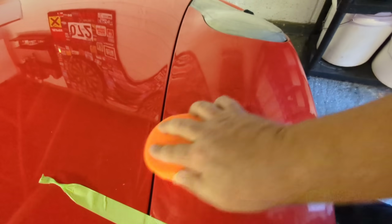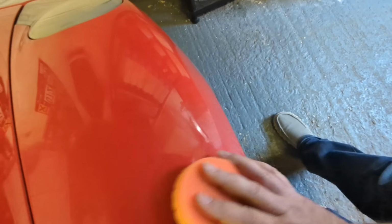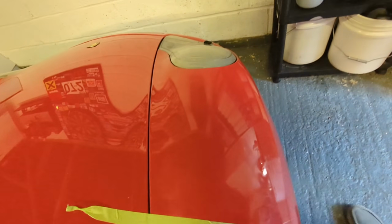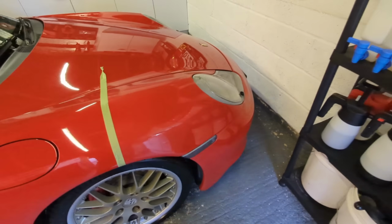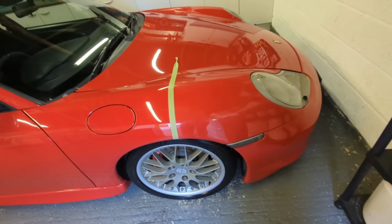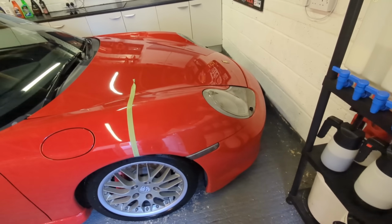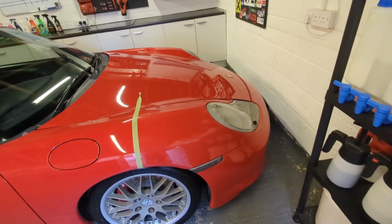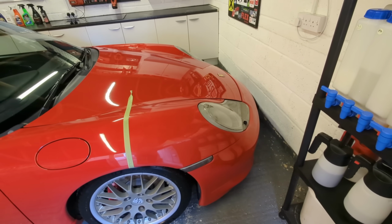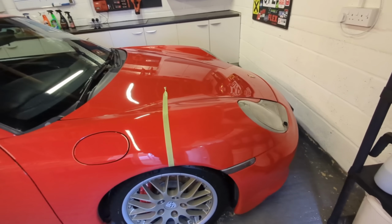I'd let the machine polisher do the work, typically with a pure abrasive. Or I would just put this glaze on, not expect miracles. Now it's applied, it's dissolved and it's drying all the time. So we can buff this product off, and then the stuff that's left behind in the paintwork is going to harden off and fill. So yeah, it's a pretty simple product to use.